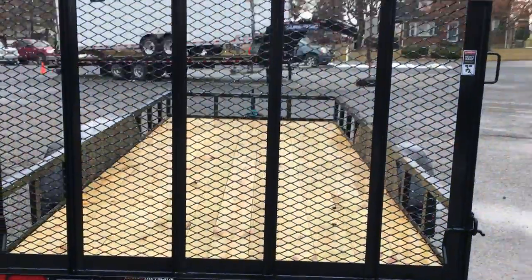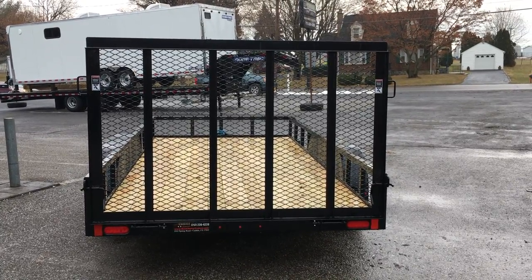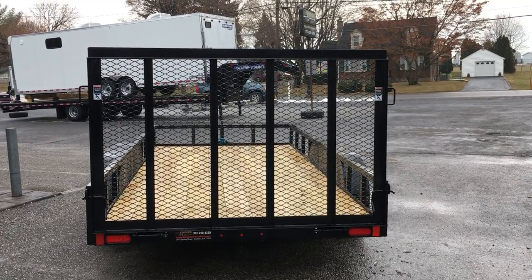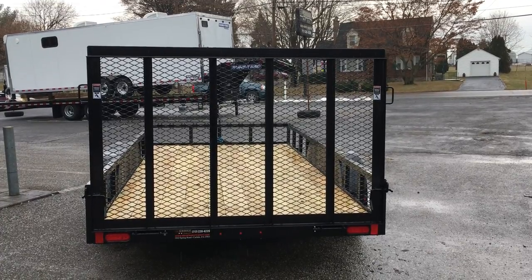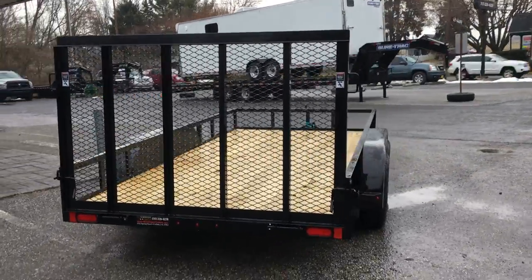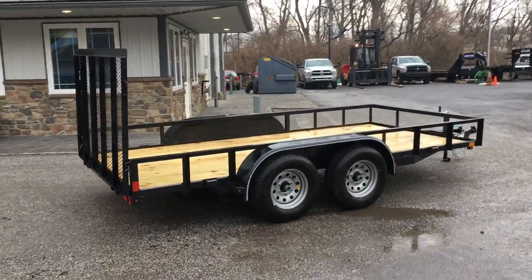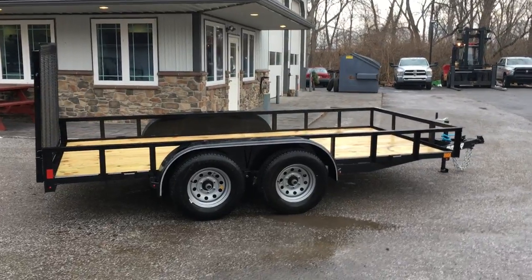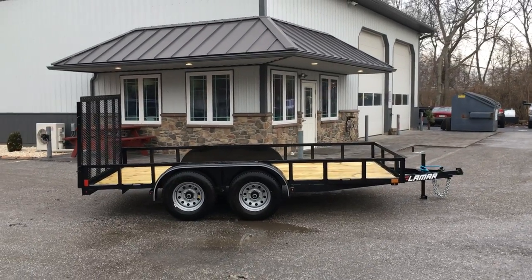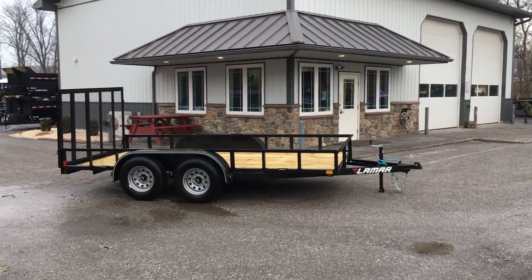They don't specifically put a weight rating on this gate, but it is an angle iron gate. We also stock our deluxe model with a tube gate. If I had to put a weight rating on angle iron, I would say most things like your UTVs, golf carts, and garden tractors would be a great fit. A box tube gate would be more ideal for compact tractors and heavier items. Some people will say this thing only weighs 1,700 pounds and it's a 7,000 GVW — can't I put my tractor up there? Well, there are things I like to refer to as limiting factors, and that gate is your limiting factor. It just isn't designed for that kind of weight. So while it can handle 5,300 pounds plus legally, the gate can't take that amount of weight. If you've got something that heavy, you'd want to consider going to our deluxe model with a box tube gate.